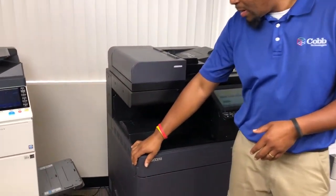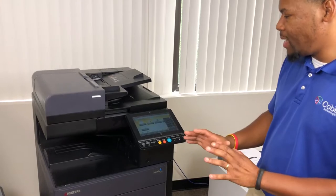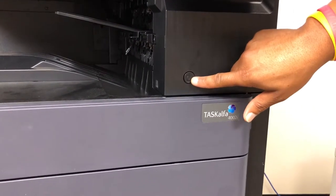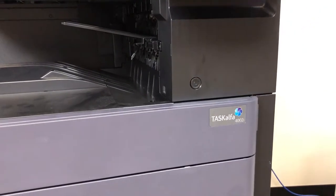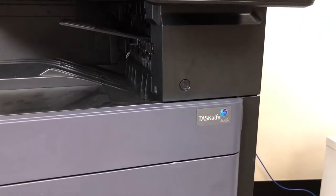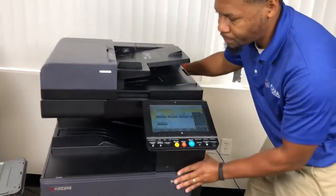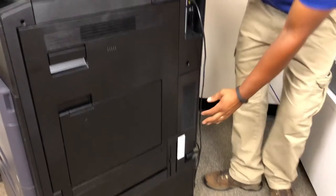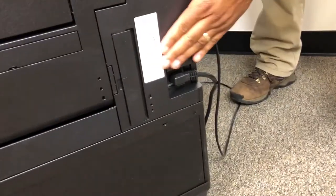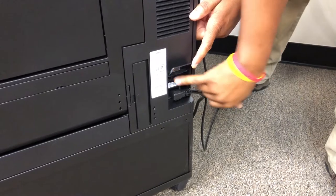This is the newer model Kyocera. It has a soft power switch and a main power switch. If you have an older Kyocera model, yours may be different, but on the new Kyocera models, some of them have this soft power switch here, which puts your machine in a kind of sub-sleep mode — your panel will go dark, but the machine still has main power. For most Kyocera models of this size and shape, your main power switch is going to be where your power cord goes into the machine. If you follow the main power cord in, in that general vicinity you'll have a little flap — pull this door up and your main power switch is right in here.